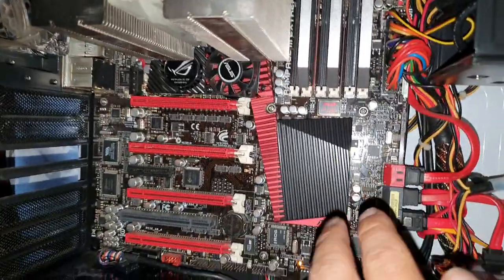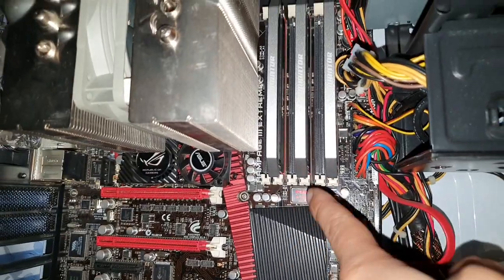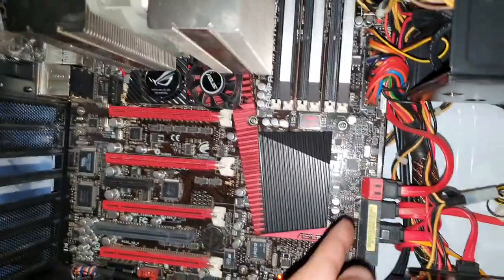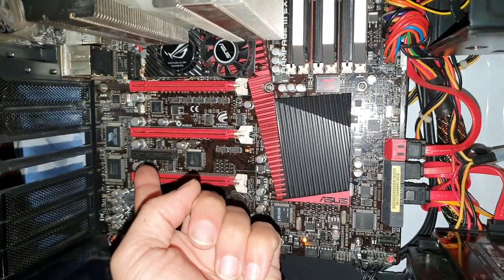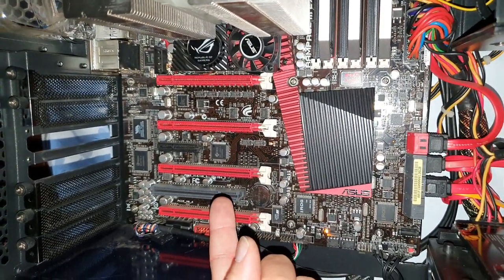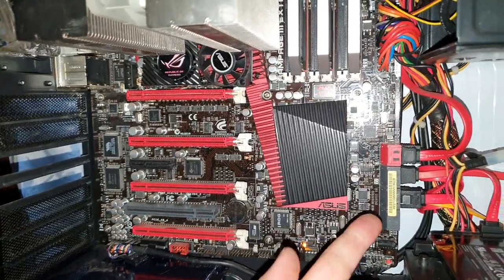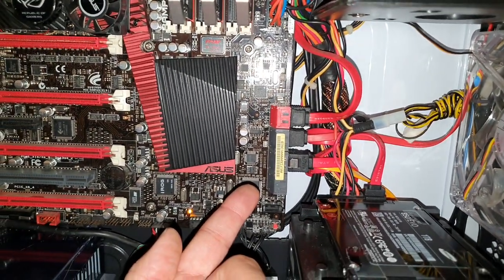So that's why I still love this older motherboard, because it's on socket 1366. I have triple channel support for my RAM, for my memories, and I can have up to 6-core processors here, like a great, let's say, i7 990X or just a great Xeon, okay? The only thing on these motherboards is that the SATA controllers are not that fast. But I don't care. You can also buy a PCI Express card that will give you new SATA controllers, which can read really great SSDs like the M.2 or NVMe SSDs with NAND chips. Really great, guys, really fast, but you don't need all that. If you can do a RAID 0 system, it will read up to 500 megabytes per second, and you don't need more. This is so great, guys, okay?